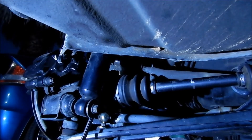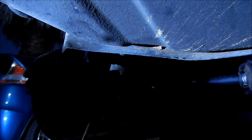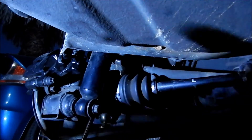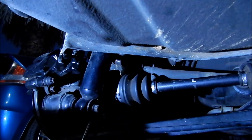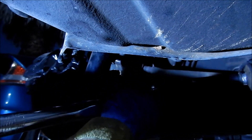All right, so it's 47 foot-pounds, or 50 foot-pounds is what the torque spec is, so I'm going to go ahead and torque it to 50. It's pretty close. It's hard to get in here. Yeah, I don't think we can torque it — there's not enough room.